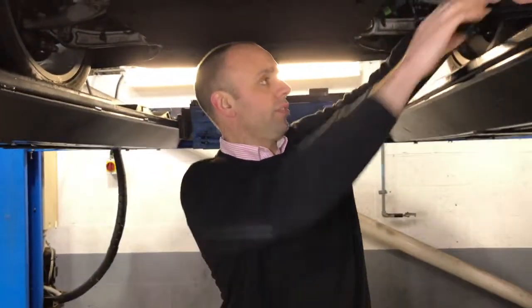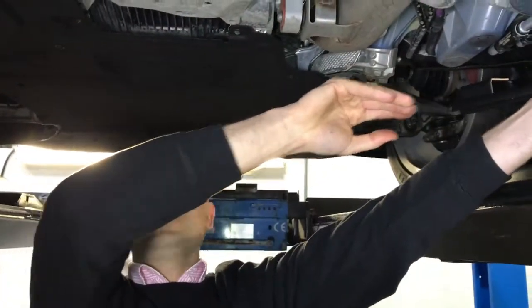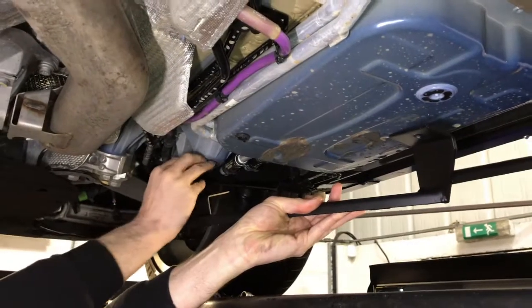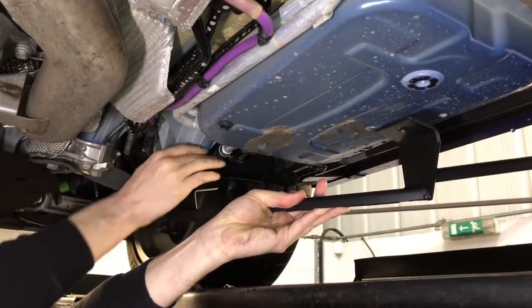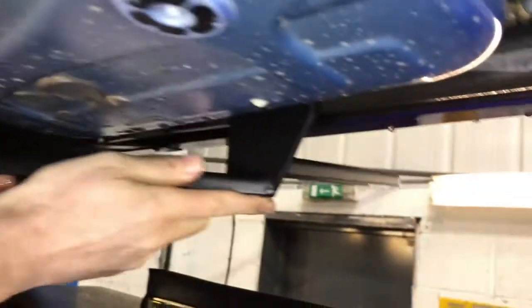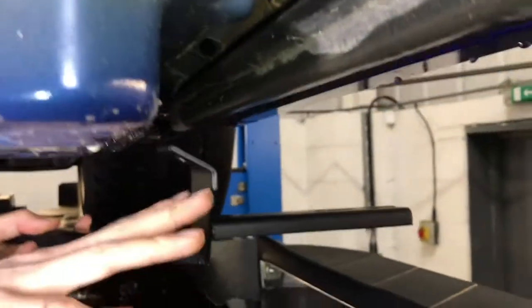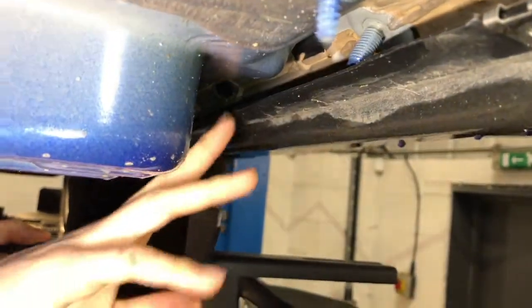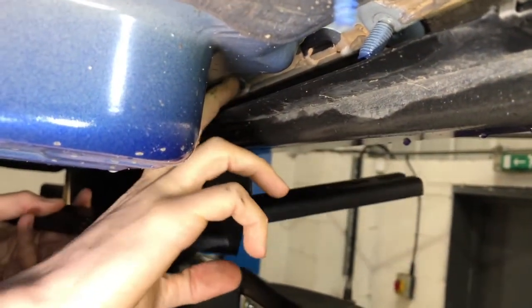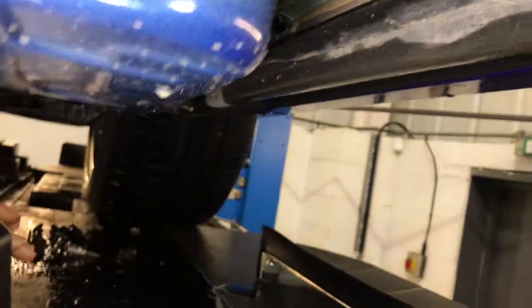So now onto the front of bracket. Get this bracket up here. So if you can see these two bung holes here, it's the furthest back one. You remove that, T-bolt sticks through there, and then on the front you've got the same issue where you have to cut a section out of the inner plastic sill. It's not detrimental to anything, to be honest with you, because you've got enough clips going all the way around to keep the plastic covers in place. You've got like a rubber bung underneath there. You have to remove that rubber bung, cut away, and then this will bolt up to there and stick out.